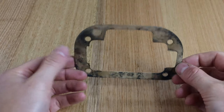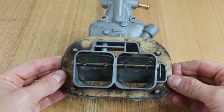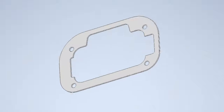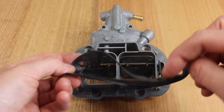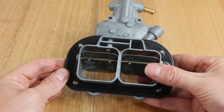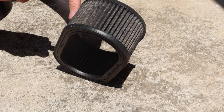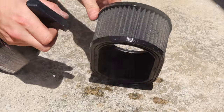The next thing on the list is the gasket for the air filter. Being that it's an aftermarket K&N filter and I don't think they even sell this one anymore, I thought it'd be easy enough to just make my own. I probably could have reused this one, but look how ugly it is - we can't have that. So here we go again, another 3D printed car part that the internet can comment on and tell me how it's not going to work. I was going to replace this filter, but then I remembered that I'd bought a K&N service kit on sale about 4 years ago, so I thought I might as well use it. I could go on a rant about the oil in these filters and why I don't use them on my EFI cars, but we'll save that for another day.